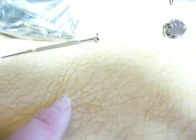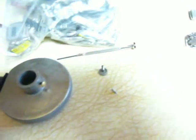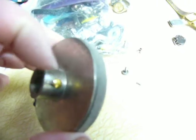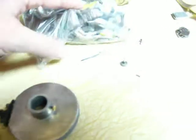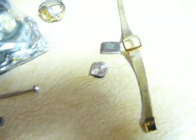After I went to the hardware store, I went to an eyeglass place in town that fixes eyeglasses. That screw had the right amount of threads at the distance apart, but it was so teeny that the head wouldn't hold the record player piece on. So I just wanted to share how I fixed that. It's so fun to listen to those old records. That's how I did it — I just got that piece from an old watch, put it in there, and it was perfect. Go to a secondhand store or ask your neighbors if anybody has any old watches they don't want. This one was broken anyway — it wouldn't wind up — so I figured if I pulled it apart maybe I could find a screw that would work, and I did. It held perfectly and it worked great.